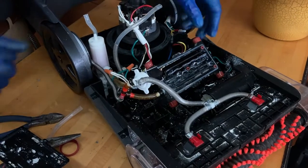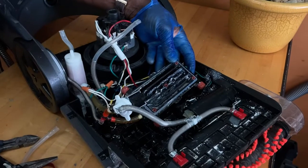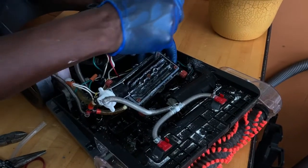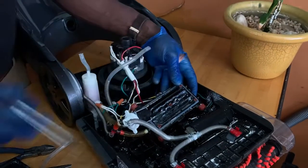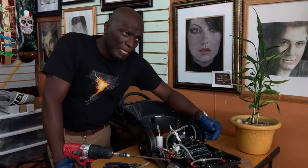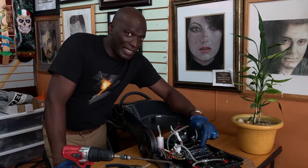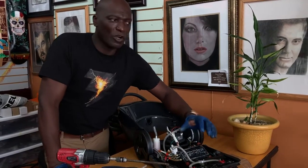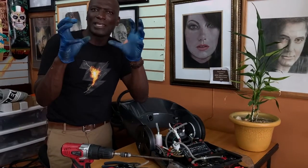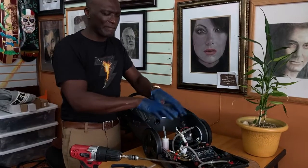If you're going to go in this far, definitely check and make sure that's cleaned out. You can dump it out and use swabs or even a small artist's paint brush — it's small enough to get in there and work it and clean it out, then flush it. To avoid this buildup: if you're going to use the heater, make sure you flush it after you use it, because the soap solution bakes. You shut the machine off, it stays hot for another half hour, water isn't moving, and whatever's in there is baking — it's like cooking.